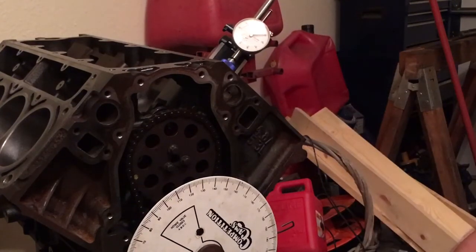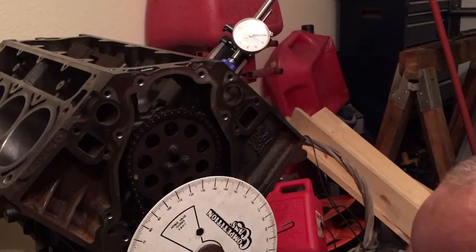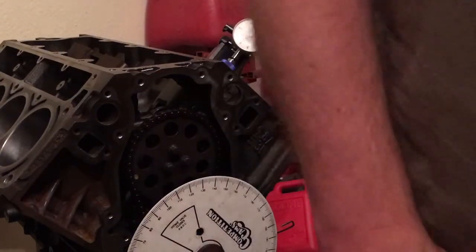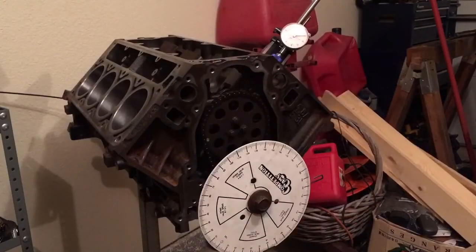It's literally how you hold your head when you're looking at this thing. I'll call it 148 and a half on the other side of the lobe. So adding 148.5 plus 66.25 and dividing by two gives 107.375 — back closer to the original 107.5 intake centerline I got the first couple of times. Then I reset everything and came out with 108 even. So right now I'm going to run through these numbers at least two more times, and if I keep getting a consistent measurement I'll know what I need to do to correct the intake centerline.